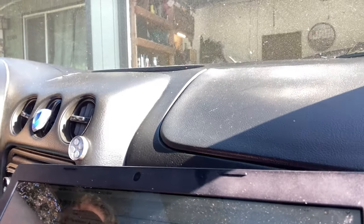So far we're literally driving like normal. We had third gear — that's three out of the four gears, then fourth and overdrive. Intake temps 110 degrees, 14.7 air-fuel ratio right now. Looks good — right there, 14.7. Awesome. That was an amazing — wait, how long was that tuned? That was a 7, 8-minute data log. Yeah, that was about 8 minutes of driving.